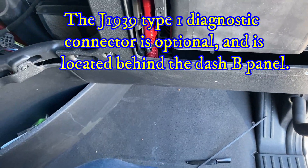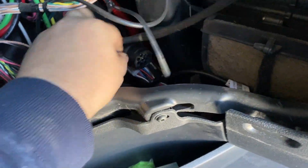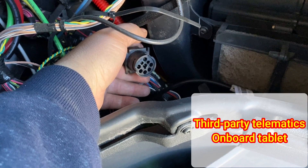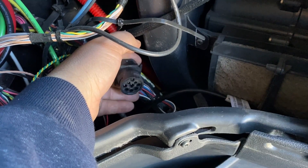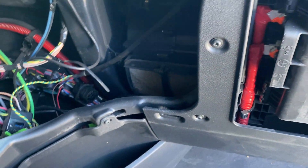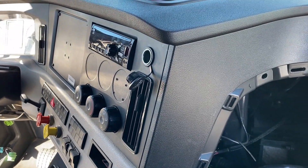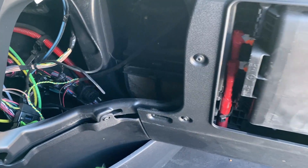Pull this panel off — there's also your air filter. Right down there is an easy tapping point, easy to get to. You can hide whatever you have behind there. It's a black connector, lower speed, and it's for any of your Qualcomm, GPS, or monitoring devices that need to plug into this nine-pin data link to get their information. It doesn't interfere with your main modules as much. It's easier to mount your stuff, you can drill holes, hide the wiring, and it looks way better — no sloppy wires hanging around by your feet.